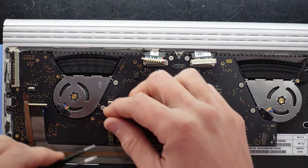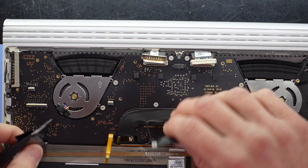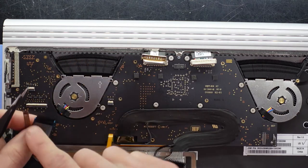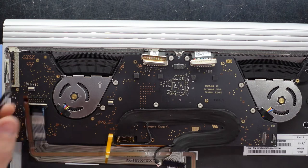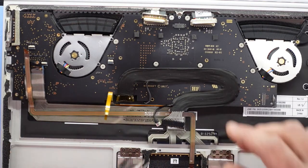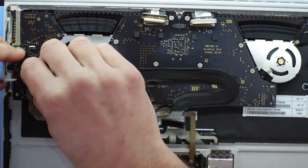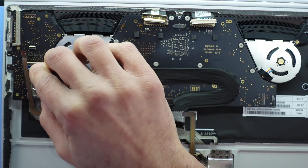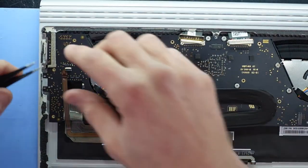From here, I should be able to reconnect the various connectors. So what have we got here? This one looks to be for the keyboard, just here. And that would be for the backlight, I would assume, of the keyboard. No, that's for the trackpad. I better move you guys up. There we go. Trackpad, keyboard, backlight, keyboard. Slide that into position, latch down. Same scenario over here.